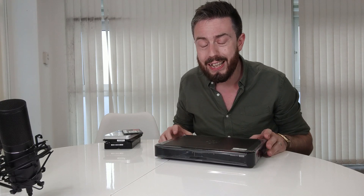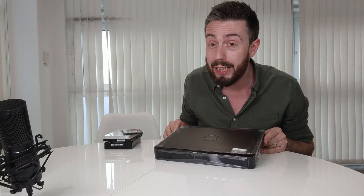Next up: the CPU. The processor inside this isn't just one step better than the 53D series before it — this is a bigger jump, arriving with the Intel N5105 or N5095. It's at least a couple of jumps ahead of the J4115 in its predecessor, the HS453DX. That CPU has a higher frequency of 2.0GHz, burstable to 2.9GHz, versus the predecessor's 1.8 to 2.5GHz. It also supports more memory, and its CPU benchmark rating is noticeably higher at 4161 versus 2706 for its predecessor.